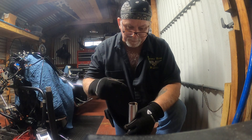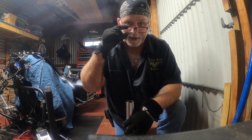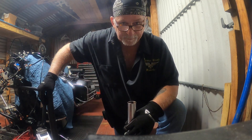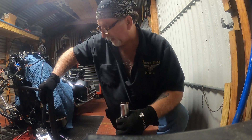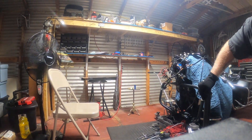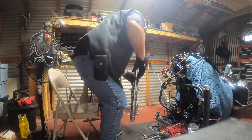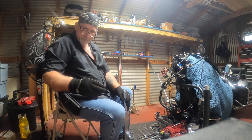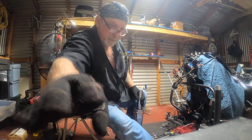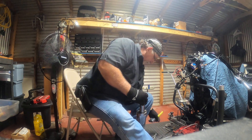My oil needs to be from this top edge right here down to the oil — it needs to be five and a half inches on mine according to the instructions. I've already got my spacer cut out. You have to collapse the fork and make sure it's down all the way before you do your measurement.